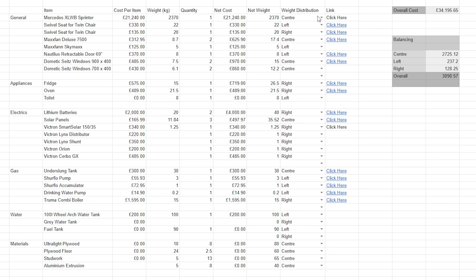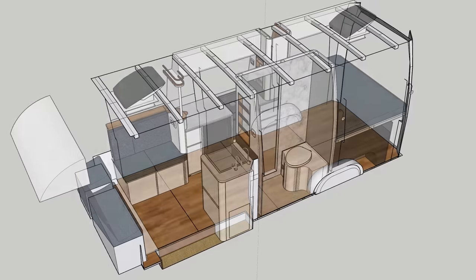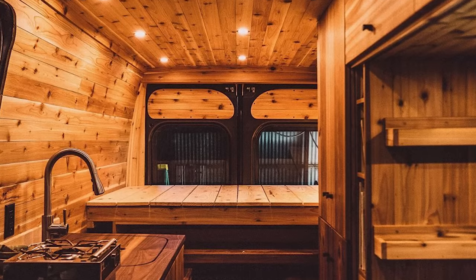What I did to keep track of everything is create a spreadsheet that totals up the overall weight of everything I'm planning on putting into the van, and also gives me a way of assigning the load to either the left or right of the van to help with balancing. This was incredibly useful for quickly drafting an idea in SketchUp and then referring to the spreadsheet to assign loads correctly. Many of the models in my graveyard were discarded because the loads were completely off — the van would have been too heavy on one side. If you want to use this spreadsheet yourself, I've popped a link in the description.